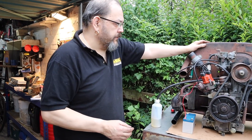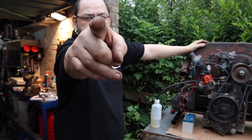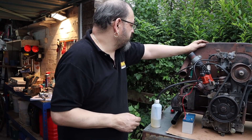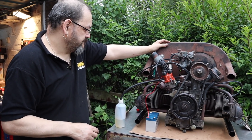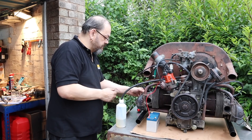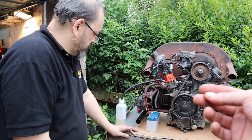I just wanted to clarify things. Emmanuel, as you know, is asking me loads of things. This is the first time I've seen the engine — I've never worked on one of those. He rebuilt it. What is Emmanuel saying? Could it be this problem? I never built the engine — he did. It's freaking well built though. It's a fine piece of mechanical engineering — 1930s design. Right, so we think we've sorted the carburetor out. Timing's alright. There's a heavy tapping sound coming out of those cylinders — I'm hoping it's not a big end or something serious. Ian and I are going to let the engine cool down and then come back and measure the valve clearances.